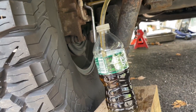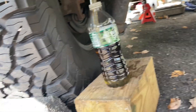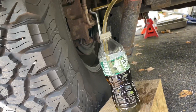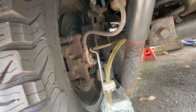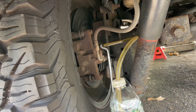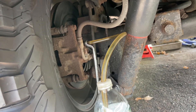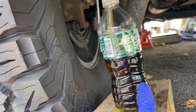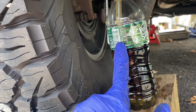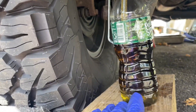In today's video I'm going to show you how I bleed my brakes. I use a Poland Spring water bottle and drill a hole through the cap so I can put this clear tube in. You can see I got my wrench on the bleeder valve right there, and I had the tube attached to it. I kept some fluid in the bottle so it wouldn't cause any air bubbles to go back into the system.